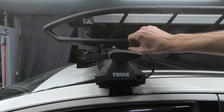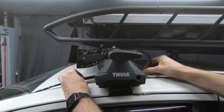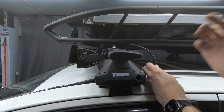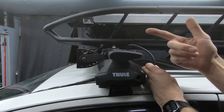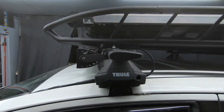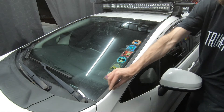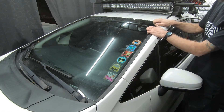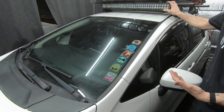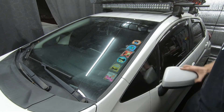I took the LED light harness and ran it under the foot boot of the roof rack. I'd also recommend adding a quick disconnect here — so if you ever wanted to take your roof rack off or just had the crossbars with an LED light bar, you could disconnect it quickly and unbolt the light bar. I ran the wiring harness down the window trim; all you've got to do is pull back a little bit. Some of you are probably wondering: does it leak? I've had this on for two years now and haven't had any water issues — I kept an eye on that like a hawk when I first installed it.